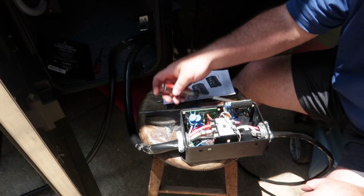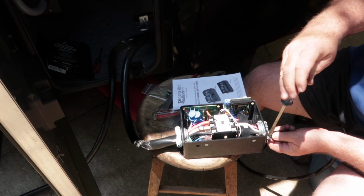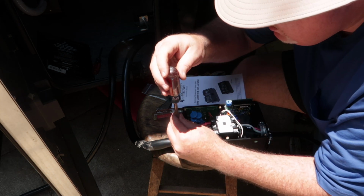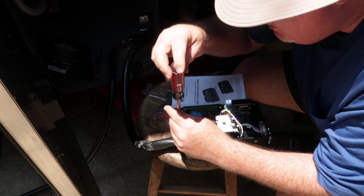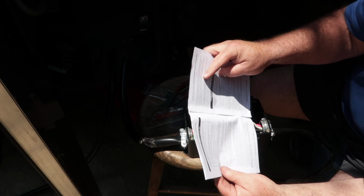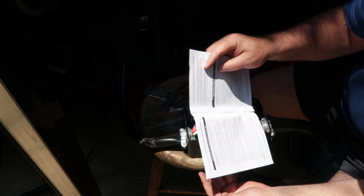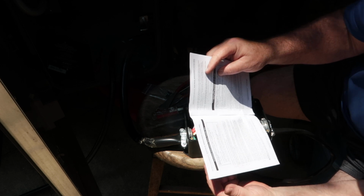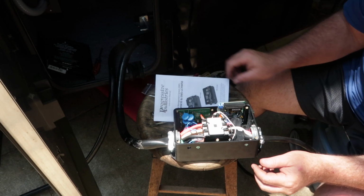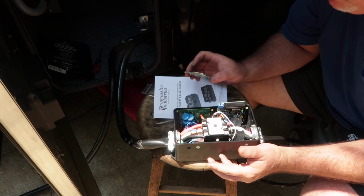I think all that's done. The wire's kind of small, so they're going down all the way. It seems to have bit though. And now this one's bigger, so I think this one will clamp down pretty nice. Set the time delay jumper on the circuit board. Factory setting is for 15 seconds. Since my ACs already have a time delay, 15 seconds will be plenty. I know I'm making it sound complicated, and it may not be, but that's the way my brain works.